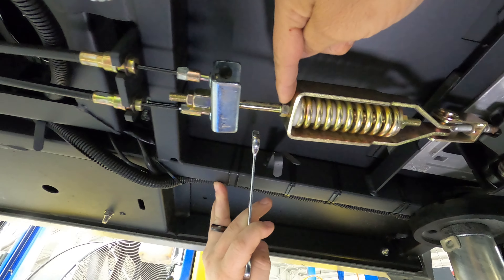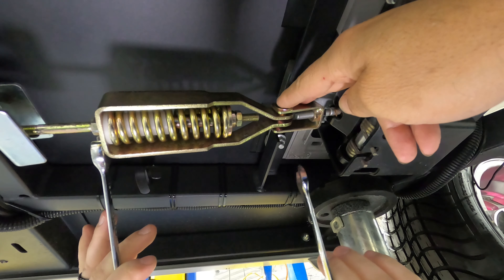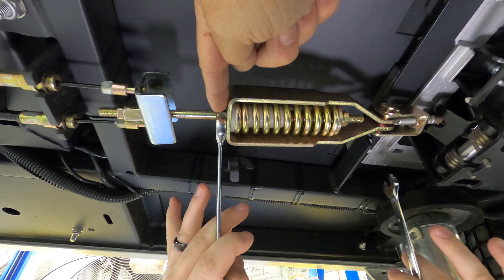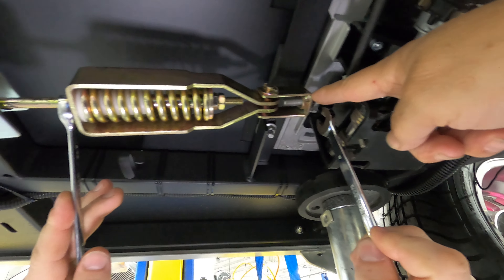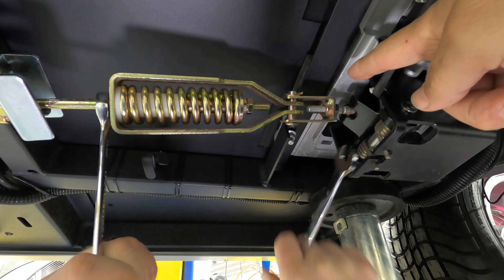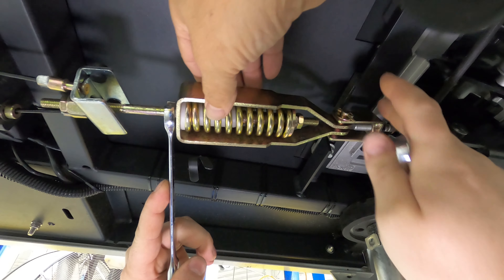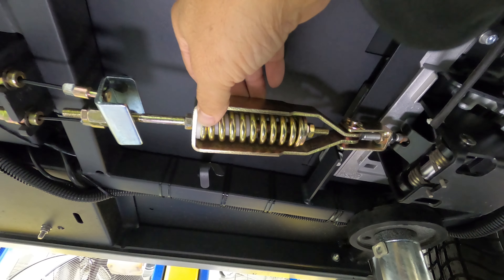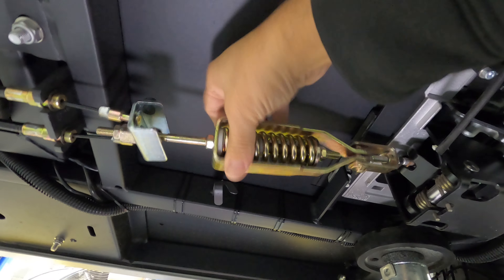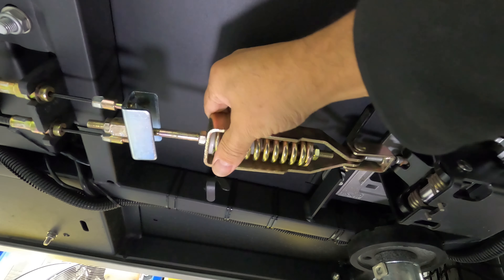We've shown you how to adjust the equalizer distance and how to adjust the brake cables back at the wheels. What we found is that by doing what we're going to show you, you can control everything from here back independently of what's from here this way. If you take this clevis off and turn it, for each half turn — one, two, three — each turn is approximately 10 psi of pressure on the pressure gauge up in the car.